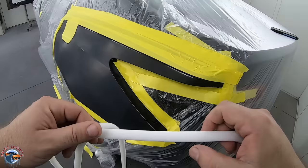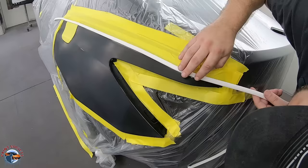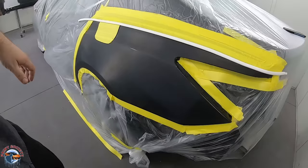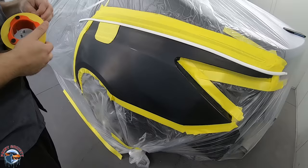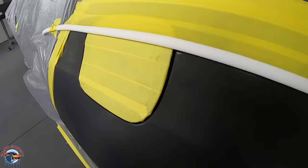For the last step, our foam tape - it has a small area that has adhesive on it. We want to put that adhesive right at the edge, with the bottom edge right between where the clear coat is and where the shiny part is. Do yourself a favor when using this tape: do not stretch it, or it's going to pull off. Make sure it's on there nice and good. On the ends it's going to want to come off, so tape it to the car. You don't want it starting to come off once you're painting. We are totally set up - we don't see any of that clear coat edge.